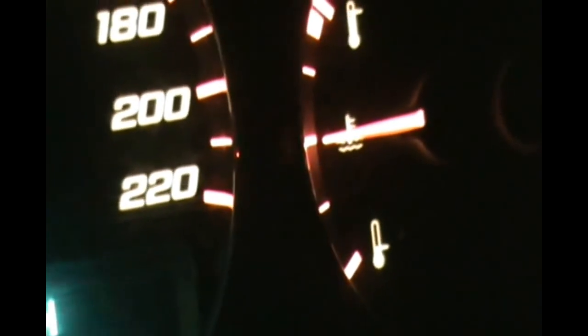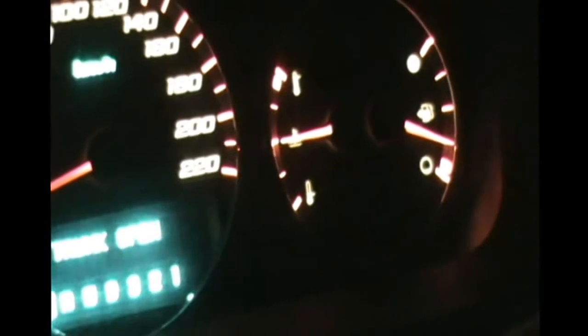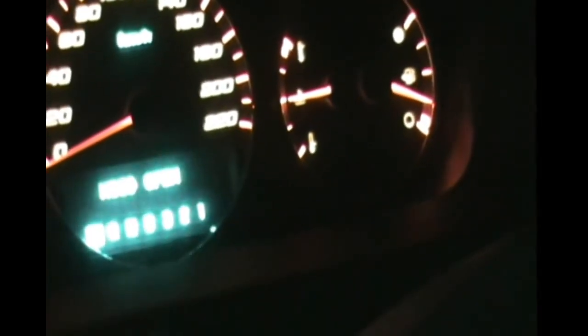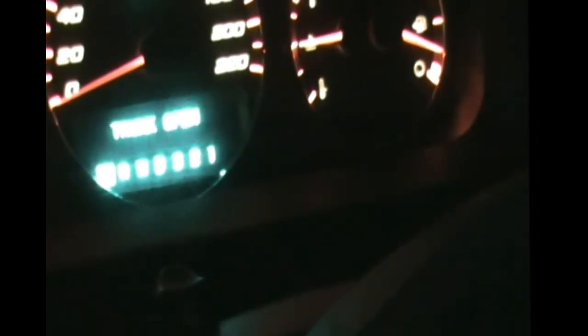And the reason why we wait for the temperature gauge to reach its normal maximum, so we make sure that the thermostat opens up. And the coolant will go inside, rotates inside the engine and the heater radiator and around the big radiator in the front. So if you need to add any more, that's the way to do it.